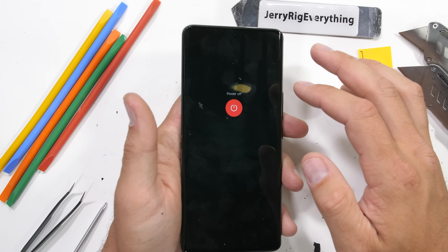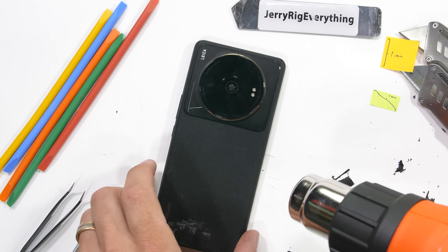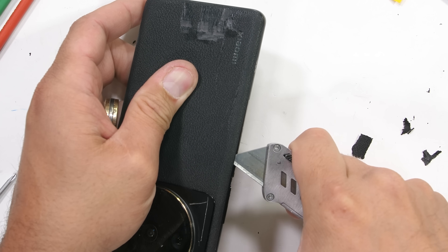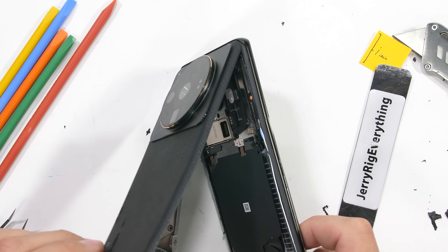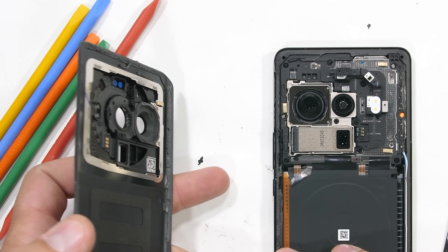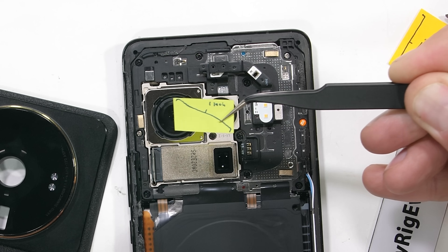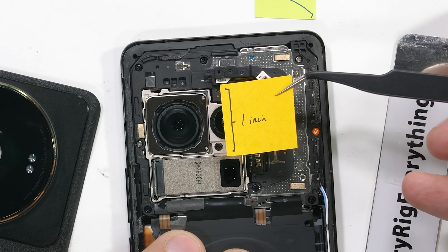With the size of the exterior circular camera lens on the back panel, it definitely makes you think that the camera might be large. But just like a lifted truck, it also could be an aesthetic distraction to conceal what's underneath. Removing the back panel is easy enough — made from synthetic silicone leather to mimic a camera body, it is flexible. After slicing away the adhesive, the whole thing can peel up and away from the phone, exposing the triple camera setup underneath. All three cameras are protected by that large circle of exterior glass, and we can see that the main sensor — the important large camera — is off to the left of center. We can also see by the physical shape of that main camera housing that Xiaomi probably isn't measuring the sensor diagonally, and if they are getting that 1 inch measurement from the sides, they are being extremely generous with that ruler.